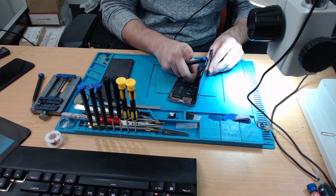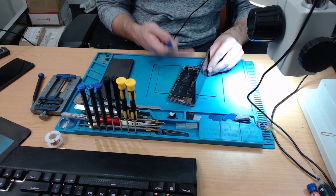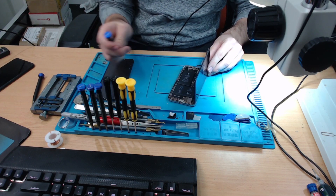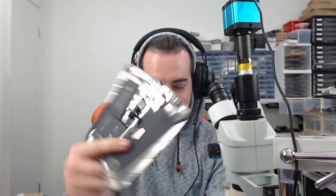As always, we've just got to take out the screws holding in the FPC cover so we can get access to the screen, the battery, and the front-facing flex, and disconnect all of those. I've left the screen connected, disconnected the battery while pulling things apart, and also disconnected that front-facing flex. With the speaker flex disconnected and we try to turn it on, it's telling us it has no battery. What do you know — with that speaker flex connected, we've now got a working and chargeable phone.